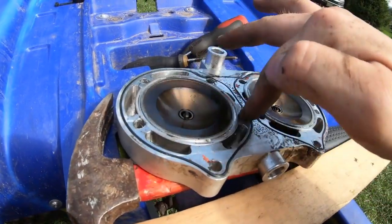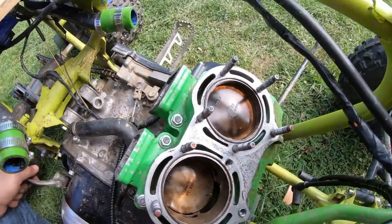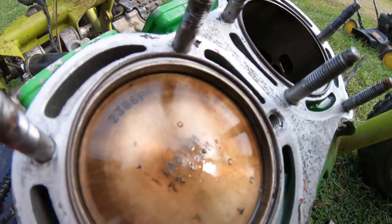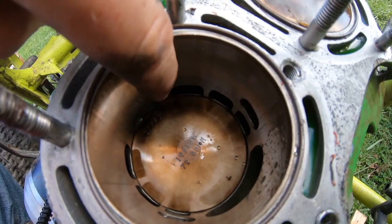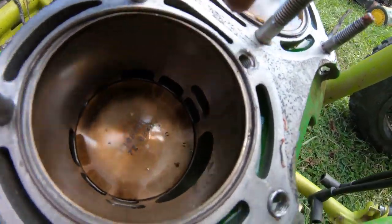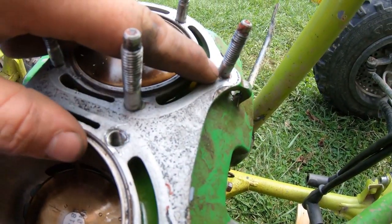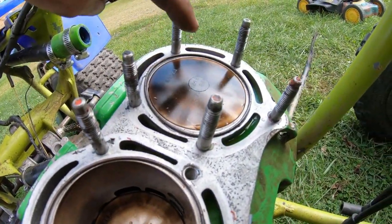The head itself looks like it's in very good shape; I don't see anything wrong with the head itself. The domes slide in and out very nicely, which tells me they're seating properly. If I rotate my kicker up and down, I don't see any cracks or excessive scoring in the cylinders, which tells me I don't have any problems as far as that goes. I really think it's these helicoils — this one is past the head surface, that one is past the head surface, and then this one — so that's three of them that I want to have repaired. The rest are okay, as you can see on the head.